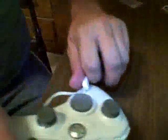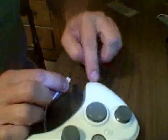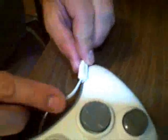Anyways, the switch and sensor. There's 2-sided tape on here. So just kind of paste that down where the spot you like it for one of your bottom fingers, where you're going to push that. And the top sensor. See, the magnet I put in here is in this lower left corner, so your sensor is going to be probably about right there. It will pick up, and there's 2-sided tape, so you peel the piece off. So if you just place it right about there, it should miss your hand, and that way it will react.